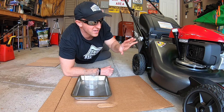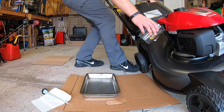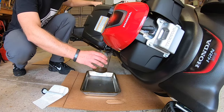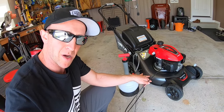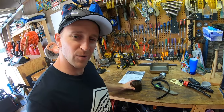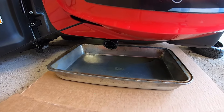Honda makes an oil change on this mower very easy. What we've got to do is just simply tip it over. I'm going to try to catch a majority of that oil into this clear container. My hope is that we'll be able to see a lot of those particulates sitting inside that oil. Another great way to get the oil out of your mower is to use one of these oil extraction pumps — I'll have one linked down below in the description, along with a video showing exactly how to use it. I just caught a majority of that oil here in this glass, and the rest ended up in the pan down below.